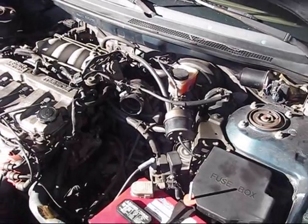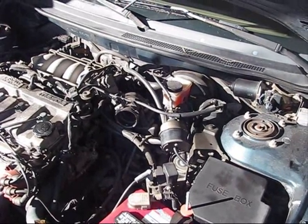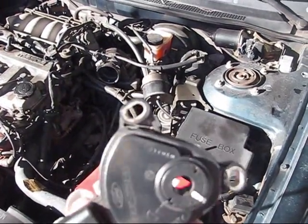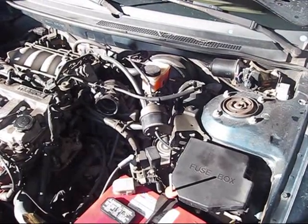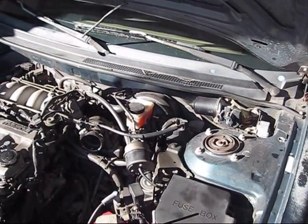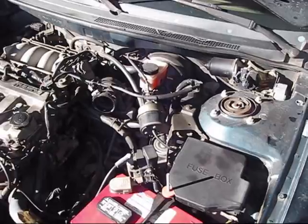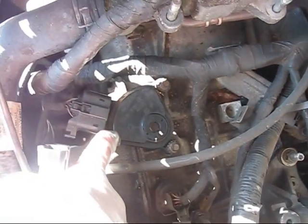for 40 seconds. That's why, after some review on the internet, reading some manuals and looking at some schematics, I determined that besides this sensor, also known as the transmission safety switch, there is also the VSS sensor, vehicle speed sensor. While plugging in my computer and reading OBD2 codes, my computer says that the VSS sensor range is incorrect. This is the transmission range sensor. The VSS sensor is located nearby the dipstick over there.